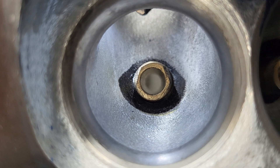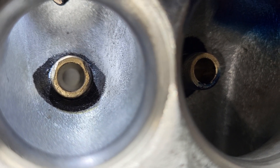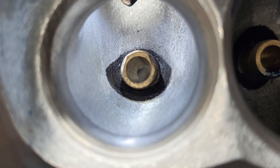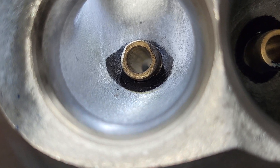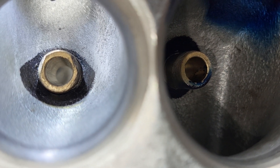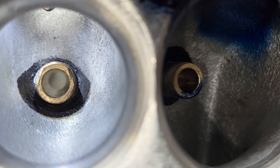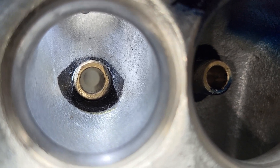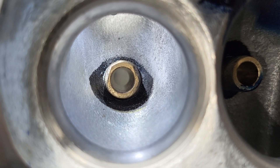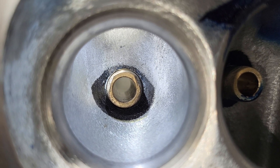On the exhaust, I took out some meat right in the middle of that bowl, right by the guide. I hit the guide a couple times with the burr — I was using a pretty rough burr and wanted to give it a little more width because I thought that's where the turbulence was coming from. It wasn't a total win — we got a few more CFM up high and the turbulence changed on the curve a little bit. Not a complete win, but I don't have much experience with this exact design. The airspeeds across the whole port are actually quite good at this point.